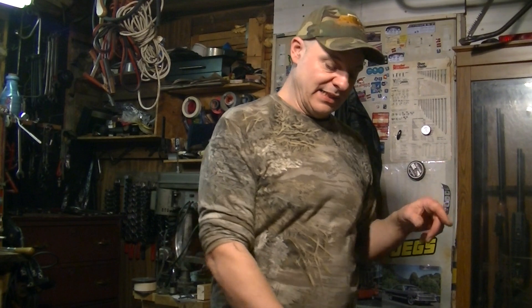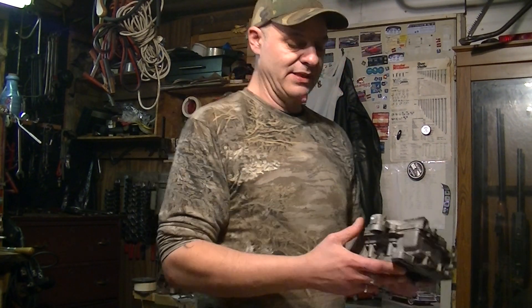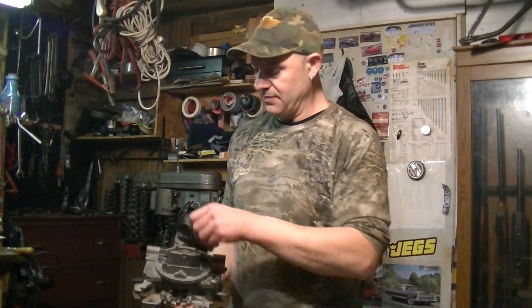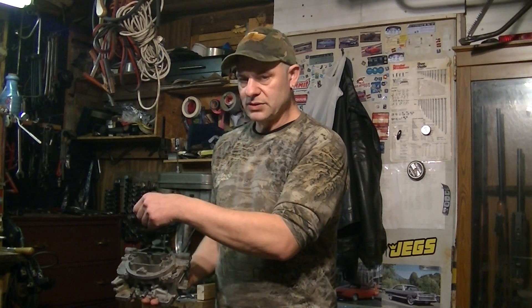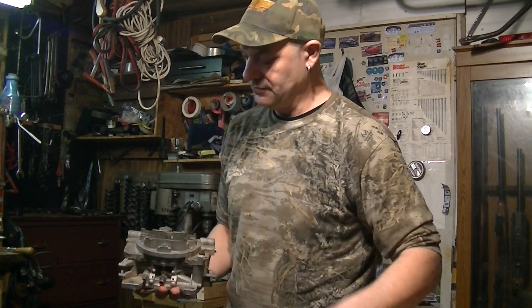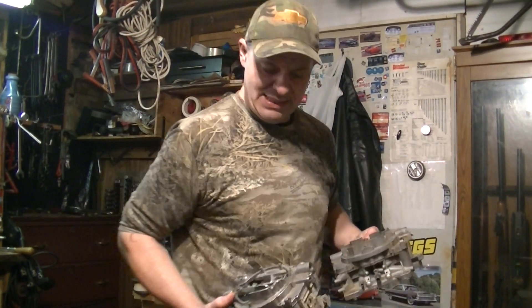What was to follow was this guy. This followed the AFB — this is the air valve. This is spring operated, and that's what controls the airflow on the secondary. No weighted air valve, so it made it a little bit lighter. It's a little bit smaller too.